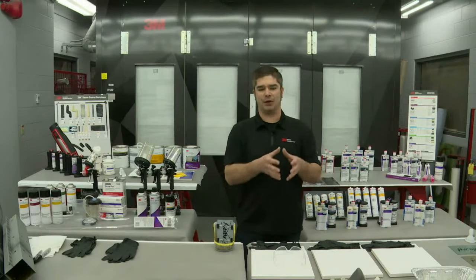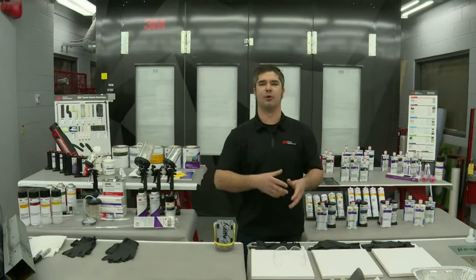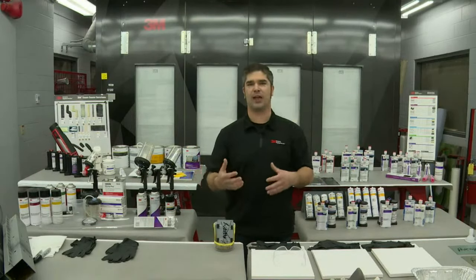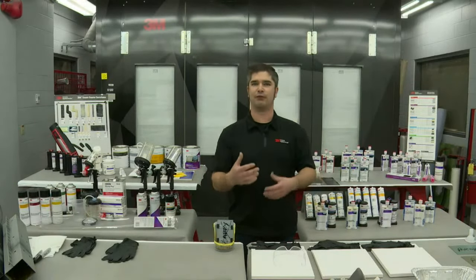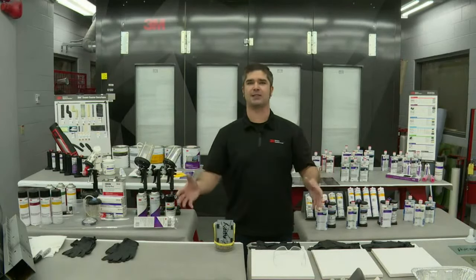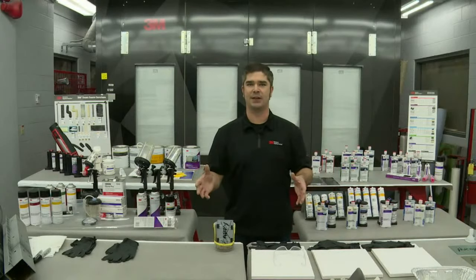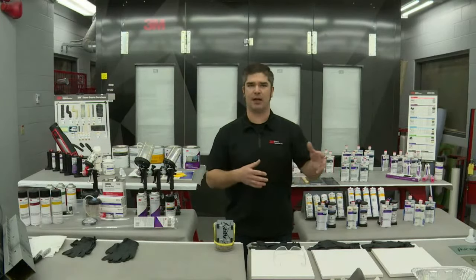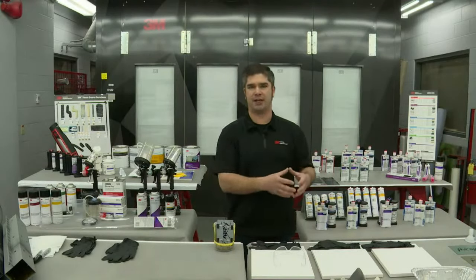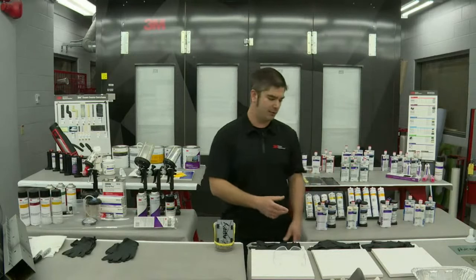And I want to emphasize they're not always in the specific repair procedure. So our estimators, our blueprinters, and our technicians need to be aware that these OEMs have additional bulletins available to find this information. And when they put out these bulletins, most often they're a blanket statement for all model vehicles within their manufactured lines, right? Like Toyota has them, Honda has them. They're referring to all their vehicles unless there's a specific change within the exact repair procedure itself.